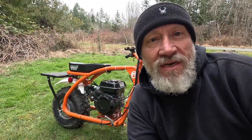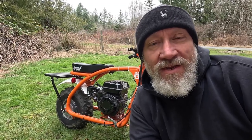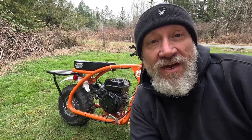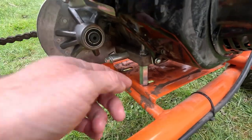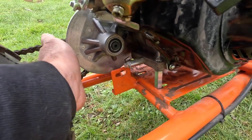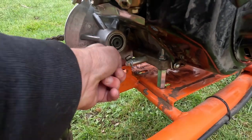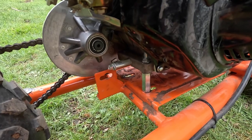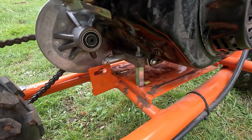It's running a lot better — the clutches are activating and speed is increasing on the rear wheel. But there's a bit of a miss happening, and I think that's because of the freer flowing exhaust pipe — now that the revs are getting higher the carb is leaning out a bit. I've ordered some new jets for the carb and I'll put those in when they arrive. In the meantime, I discovered something else: one of the hex couplers vibrated loose, and when riding the bike the whole engine is torquing left and right. I'm going to make a proper spacer out of square tubing.